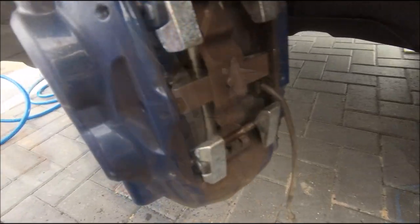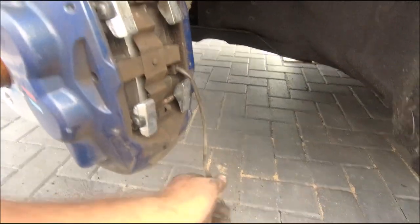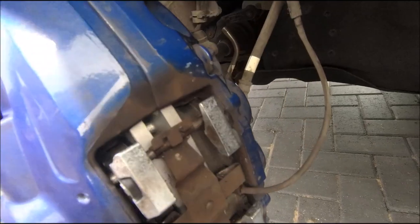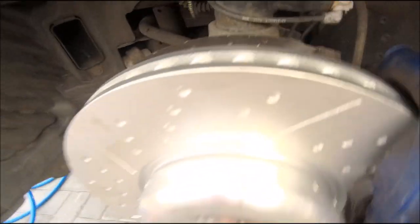Don't forget your wear limits. Pins back in, all nicely secure. They go under those clamps there and that holds them in tight. The wire for your wear limit - there's a box just here and it clips into that, then it feeds through - one there, one there, and one on the back of your pad as well. Basically in the box, one clip up there, one clip just there, and there's another one there too. We're all good, all clipped in.